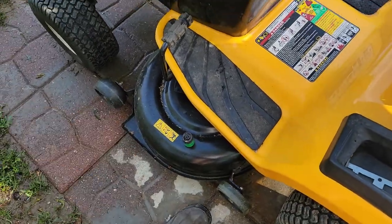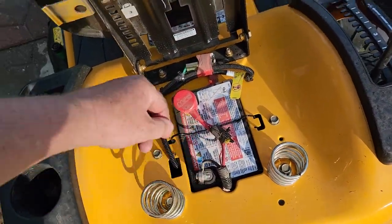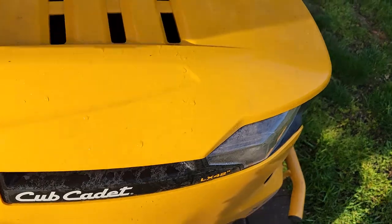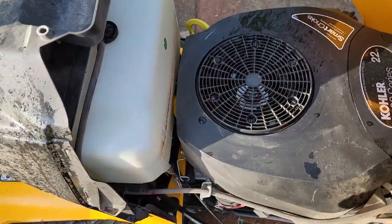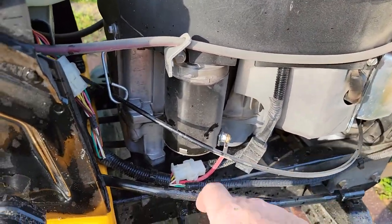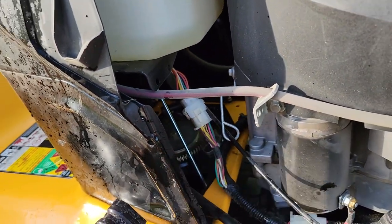Here's okay. The deck's okay. Underneath the seat, here's okay. Let's open the engine compartment. I do a light spray right in here — it's not too bad down in here. I don't shoot it in there; that's where the spark plug is. I don't shoot it at an electrical connection, same with all these electrical connections.